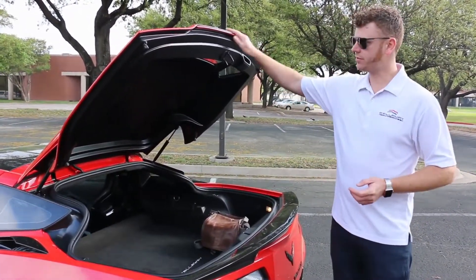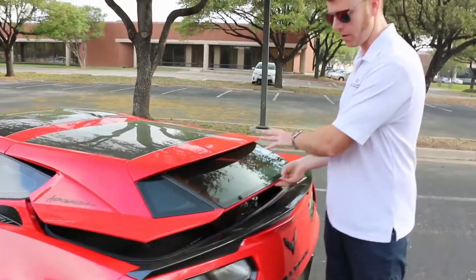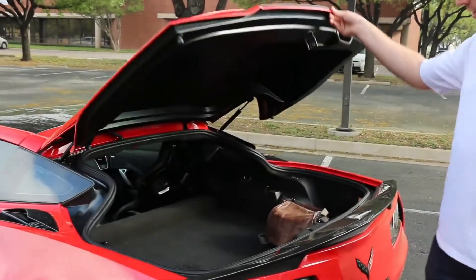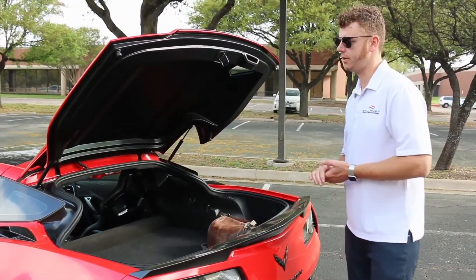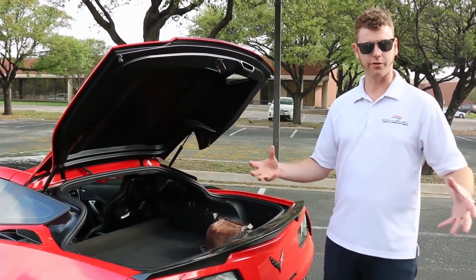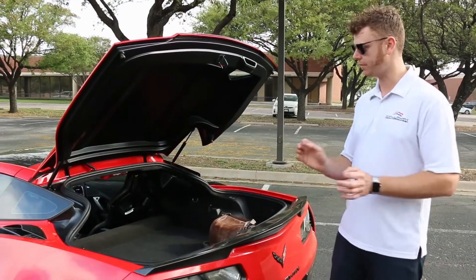The construction is interesting. It's all carbon fiber inner and outer shells and hatch, with real tempered glass bonded in place with a defogger — still fully functional. The upper rear spoiler is bonded in place and entirely carbon fiber, machined from CAD data. The car is all designed in CAD with directly machined tooling for the carbon fiber construction. The first parts out of the mold are the first production parts, which are on this car — a perfect fit.